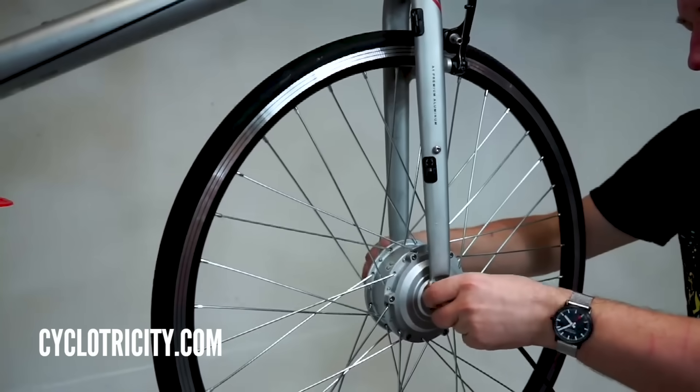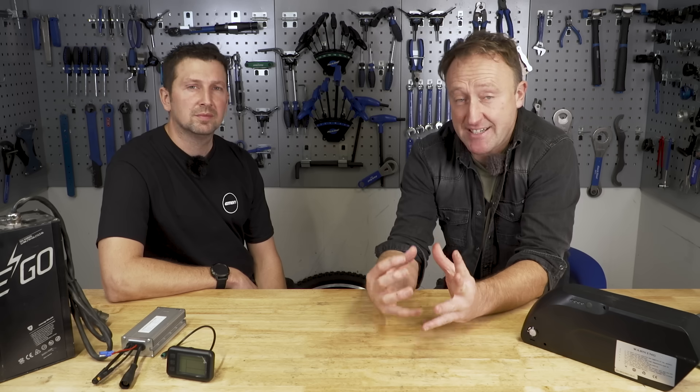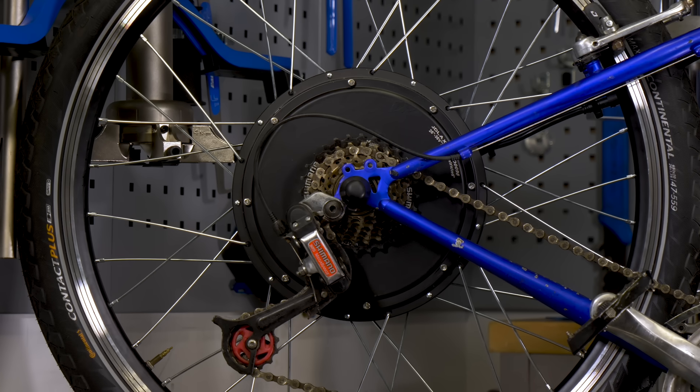So you've got the bicycle you're going to convert using your e-bike kit. What are the main types of kits on the market? First up, you've got your front hub-drive kit, which powers the front wheel, clamped in the front forks and propels the bike forward. Then there is the mid-drive kit, which is centrally located on the bike and powered off the cranks. And bringing up the rear, you've got the rear hub-drive unit, which bolts into the rear drop-outs and propels the bike forward.